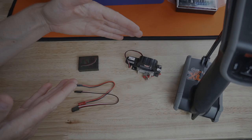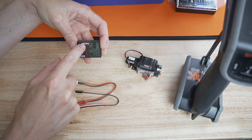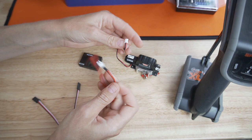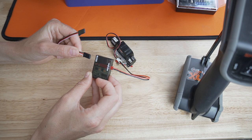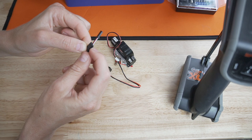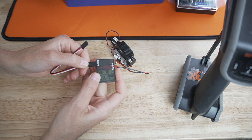First, before I install it, I'm going to lay out all the components. So the winch controller — I call this the woob box. This is the outlet for your winch and this is the outlet that's going to go to your battery. Let's get everything working and programmed first, then we'll install it on the front bumper. Take this connector and plug it into your winch, then plug this into the winch port labeled W. Then take this servo cable — this is the port that goes to your battery, though technically it goes first through your receiver and then to the battery, so it gets power from your receiver. These cables have a little notch in them, so I had to shave a little piece off with a hobby knife to be able to plug it into my receiver. Plug the unshaved end into the battery port on the winch controller.